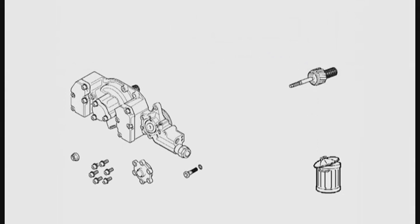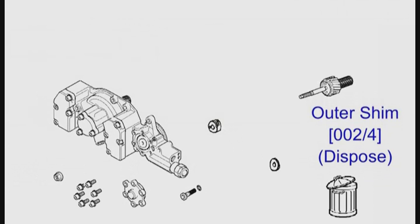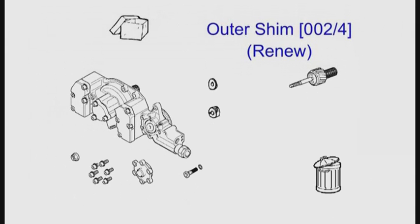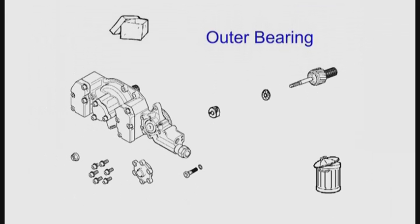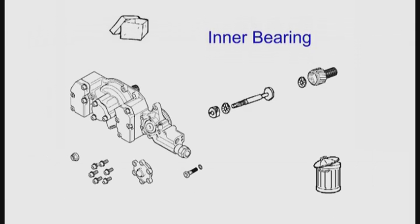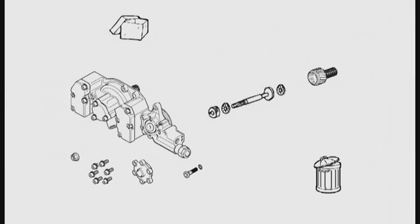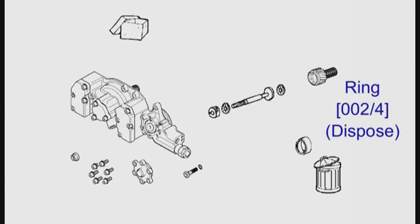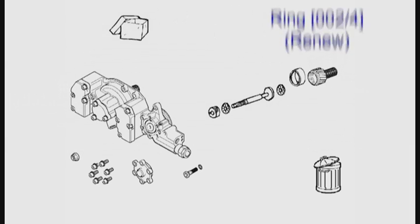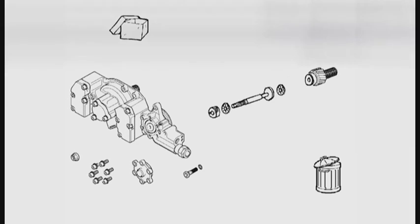Don't fit the new o-ring yet. Remove the shaft. To overhaul the pinion, remove the gear locking ring. Dispose of the first shim and replace it — the shims and shim rings are only available from Baysan. Remove the bearing and the shaft. Remove the other bearing. Replace the last shim and the shim ring. Reassemble the pinion.